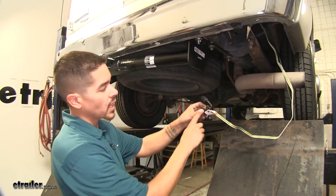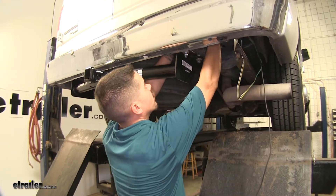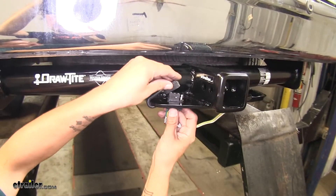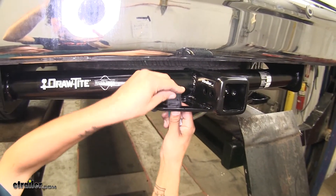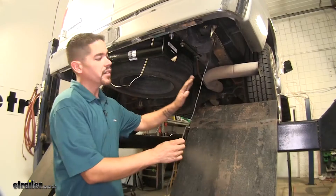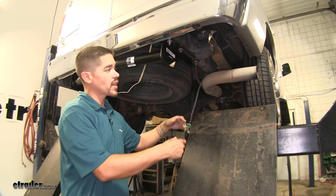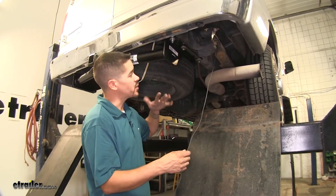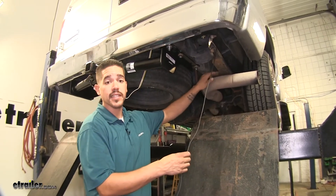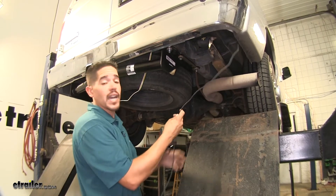For our four-pole wire, I'm going to go over the frame here and route it towards the center of my hitch. I'm just going to attach it to the hitch using the dust cover for now, and we'll come back and tie up the wires later. As mentioned before, we are going to have to run this black wire up to the battery. Everybody's going to do it a little bit differently — you want to stay away from any moving parts like suspension or any heat sources like the exhaust. I'll go ahead and run this and when I'm done, I'll show you how I routed my wire.